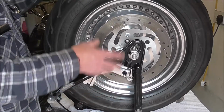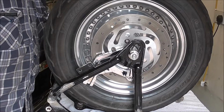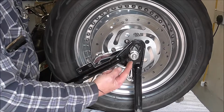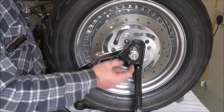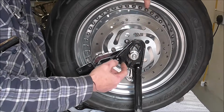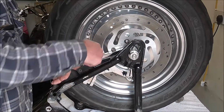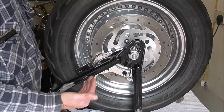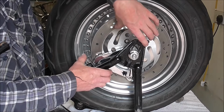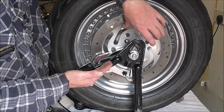But anyway, the wheel came out while I did that, and then when I put the wheel back in, to make sure, as you'll all know, when you adjust your wheel, it slides in a straight line up its slot on both sides. So what you need to do is make sure that this bracket is in line with that, so that as the wheel moves and pulls the bracket with it, the bracket isn't trying to fight like a plate that's on at a stupid angle.